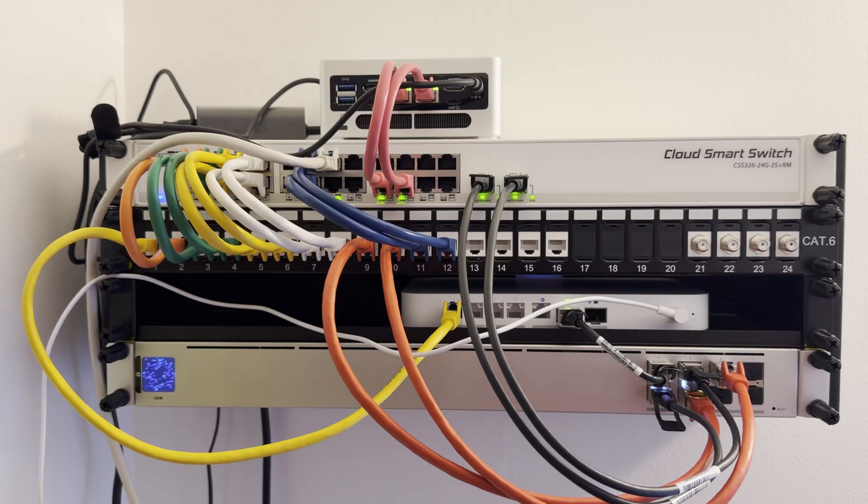But the real benefit of this whole upgrade is mobility. Right now the Mac Mini is sitting there, but that's not where it's going to stay. With this new setup going through the local network, I can move that Mac Mini next to my 10 gigabit switch, or move it right down to the bottom of the house next to my main server rack and integrate it into another 10 gigabit switch. I now have the freedom to move this Mac Mini anywhere in the house and still get 10 gigabits per second — that's amazing for setting it up anywhere as a home lab. With the cable connection I was getting 37.8 gigabits per second; I'm now down to 9.4, but for Time Machine backups that's fine, and 10 gigabits per second is great for a lot of different situations.